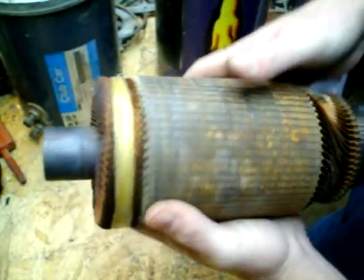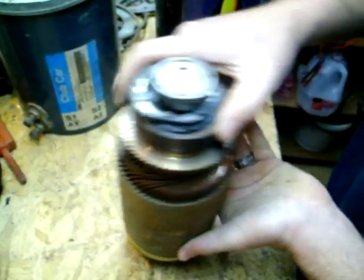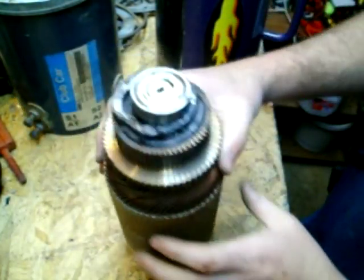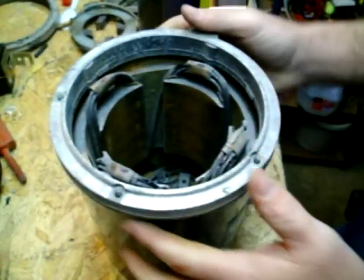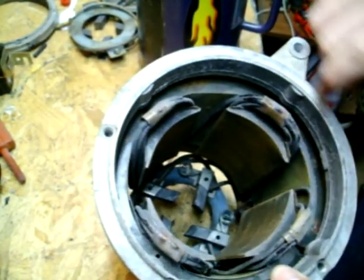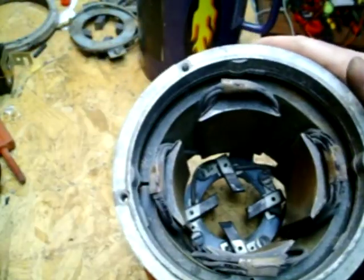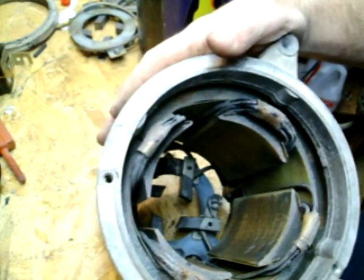Here's the stock one — it's been sitting for a while, and these are pretty heavy. I'll clean up the comm and rewind that one. What I'm going to do is rewind this one for speed with less turns, and wind this one for torque with more turns. The windings are still in there — six turns per core — and I'll do seven, possibly eight, depending on how hard this wire is to wind inside of there.